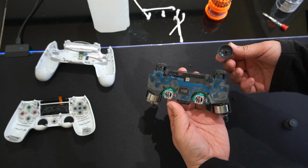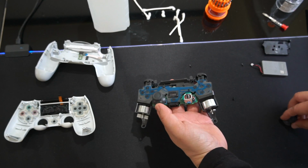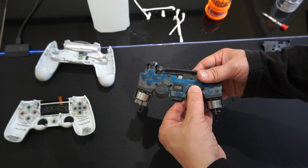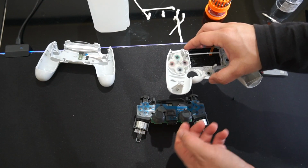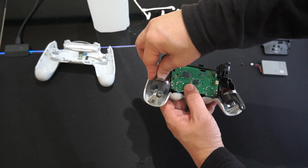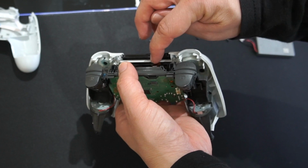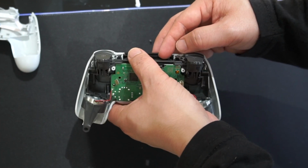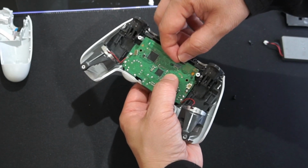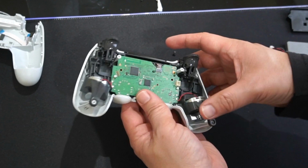Okay, so now I'm going to put it back on the thumbstick here. Snap them back on like that. Put this one back on. I'm going to put this face back on here and turn it around that way. But here's the tricky thing. The wire has to go back into the hole here. There you go, slide back in. Then I'm going to reattach this wire right here. Just got to be gentle with it. Bend it down, just push it in.